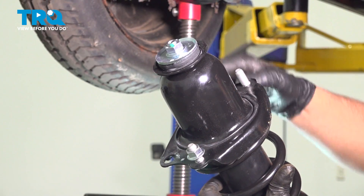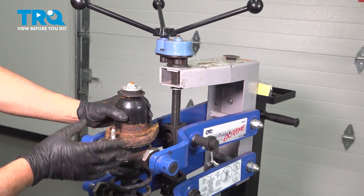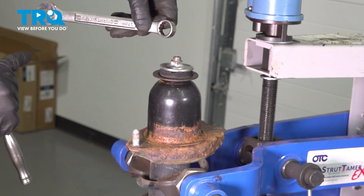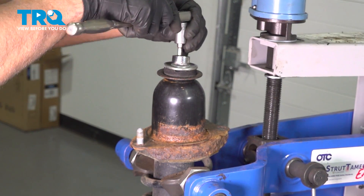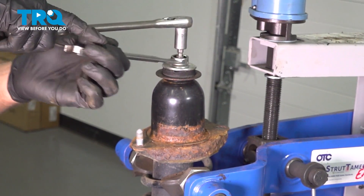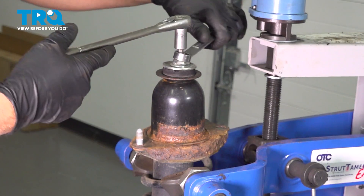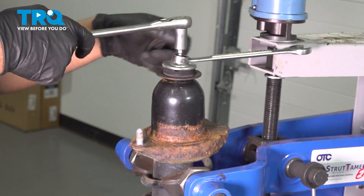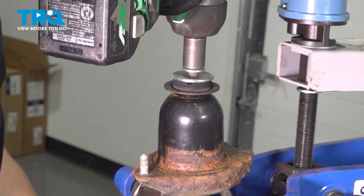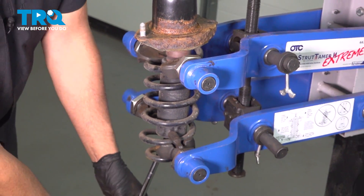Just the two nuts on the side of the mount. Take the spring and shock assembly and put it in a spring compressor and compress the spring. We're going to take the nut off — use a 17-millimeter wrench and a 6-millimeter hex socket just to hold the stud from spinning, loosen that nut up. Once you get it loose, you might be able to use a gun with a 17-millimeter socket. Slide that off, take the nut off, grab the shock, and slide it all the way down.